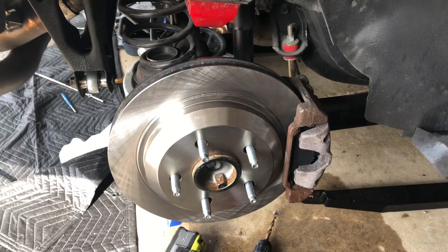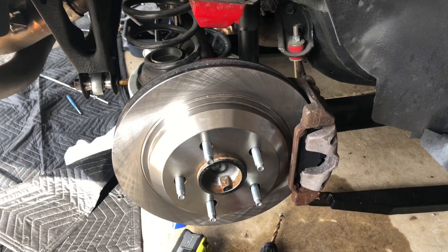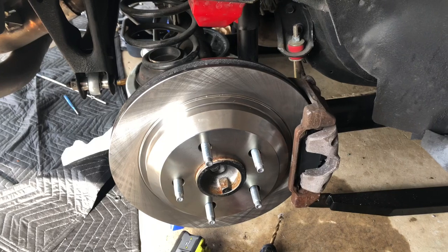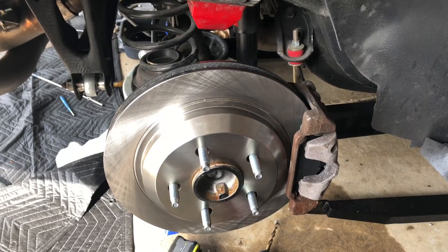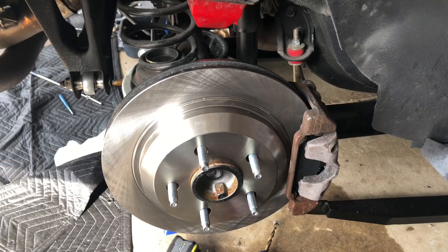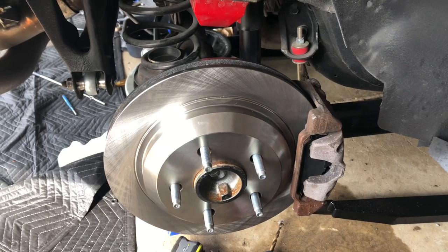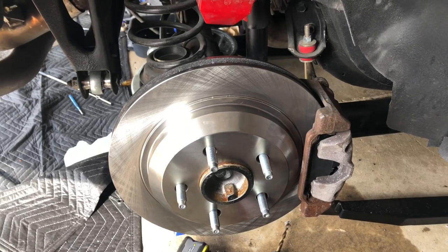This is the finished product - this is the passenger rear side. This side, the brake line didn't need any type of adjustment other than bending around to the other side and screwing it in. The 92 third gen, at least this one, has a bubble flare already, and the fitting hooked right up to the 2002 brakes. So we're good to go, it's all installed. This is the finished product. Like and subscribe - I can't wait to get this thing out on the road.